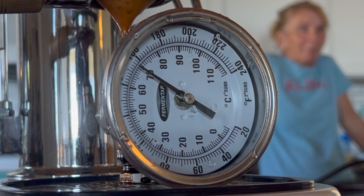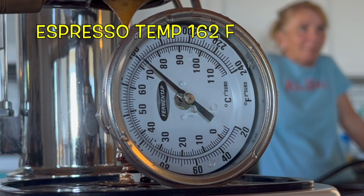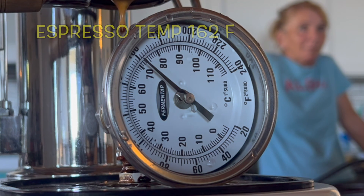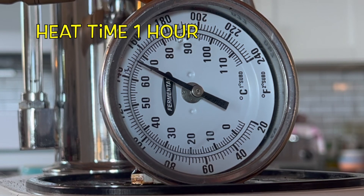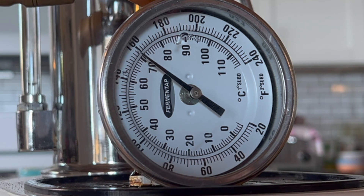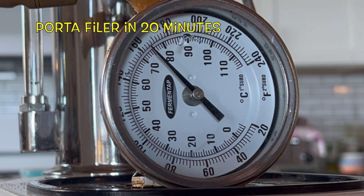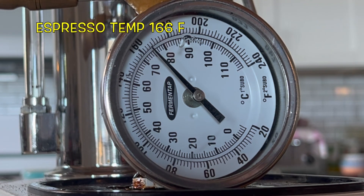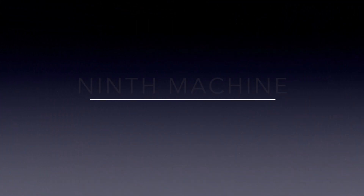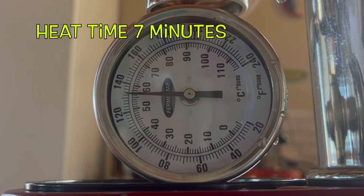Almost every machine has had the exact same temperature. After a full hour — she's getting really low on water — with the portafilter in for 20 minutes: 166°F. That's consistent with putting the portafilter in — it warms the basket and brings up your temperature a little bit. Machine nine: original cap, works pretty good, 7-minute heat-up.